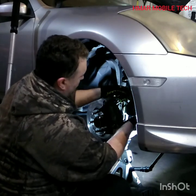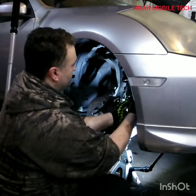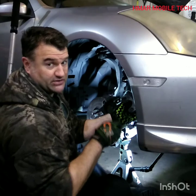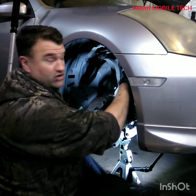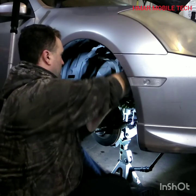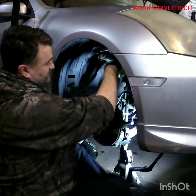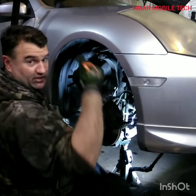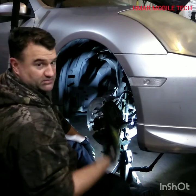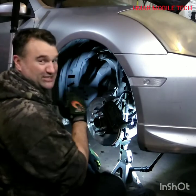When you take the caliper off, don't rotate it in a full circle or you'll mess up the brake line. You know the brake hose is straight by following the lines in the hose — as long as they're straight and not twisting, the hose isn't twisted. I found one of the strut rings and hooked the S-hook and caliper to it so the hook holds the caliper's weight, protecting the brake hose. The biggest thing is not doing damage to your car while trying to fix it.